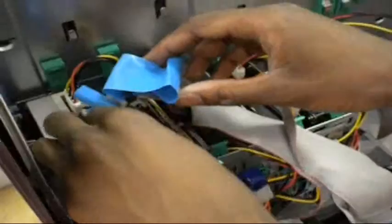Now what is that right there? Those are IDE cables, IDE data cables. That's for two optical drives, DVD and CD drives. Again, those just go directly into the motherboard once you get those two on. Let's watch that missing pin. Those can be difficult sometimes. And that just plugs directly into the motherboard also.